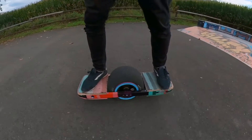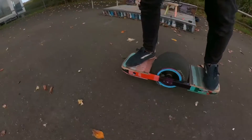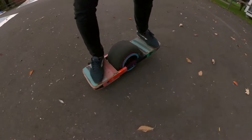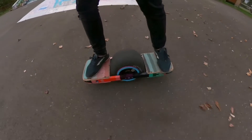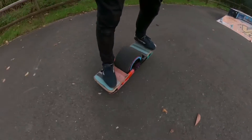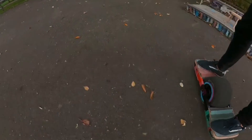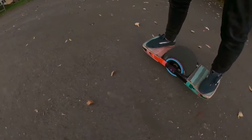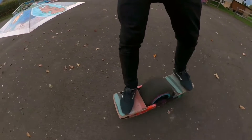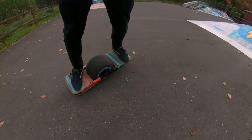What you can do is make some quick pushes or some hard brakes, and if the motor doesn't crunch, everything is fine. If you hear some motor crunching, or your board is not level — you feel the nose is low or high — then you have to do the IMU calibration. For motor crunches, you need to do the motor detection, which is what we do next.